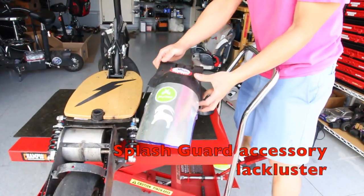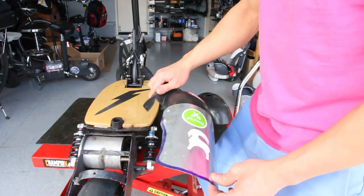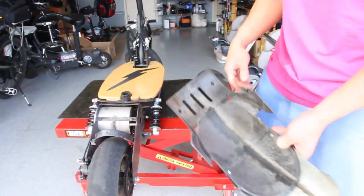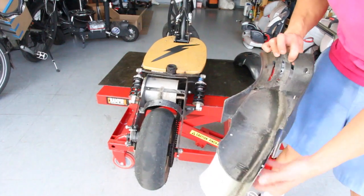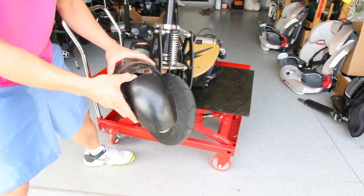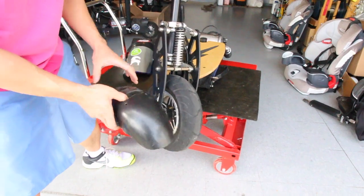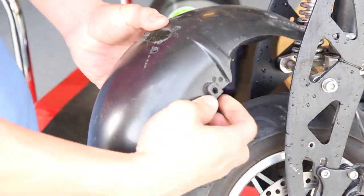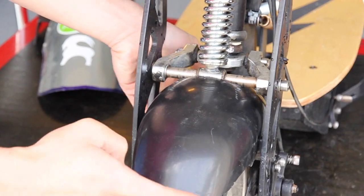This is the rear splash guard I purchased from Chris. I made a little modification — a small aluminum sheet metal add-on — because this splash guard is meant for the 1000 watt and 800 watt model. Since this wheel is 12 inches, it doesn't protect everything from splash, so I had to rivet this little piece on here. The front splash guard is also meant for the 1000 watt and 800 watt model, not the larger 1500 watt lithium model, so I had to drill holes in the fork to accommodate the corresponding holes and make a cutout at the top just to make it fit.